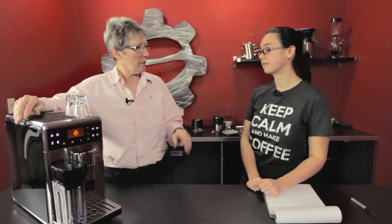My experience has been soupy pucks happen when the grind is too coarse. That's one thing. Also, an oilier bean will make a soupy puck — we don't recommend oily beans in these machines, so you want to cut that out. Mostly it's the grind.